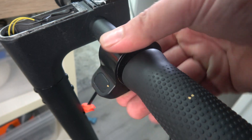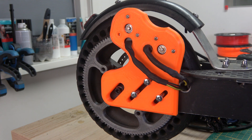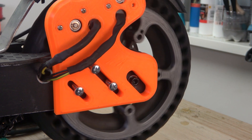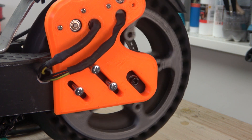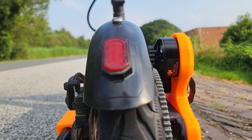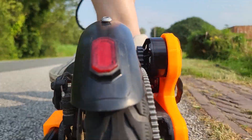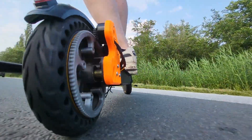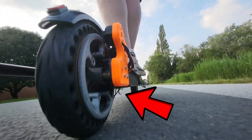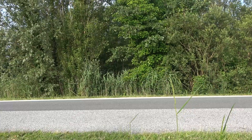Let's see if everything works as expected. It turned out the problem was that one motor was turning clockwise and the other counterclockwise. Luckily this was quickly solved by simply swapping two motor wires. Let's first do a quick lap to see if the top speed of 50 miles an hour according to the scooter's specifications is correct. To get an accurate reading I disconnected the motor wires for this run, because I wasn't sure if them working as generators when not being used would increase the rotational friction or not.